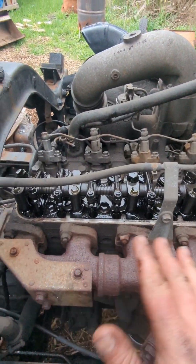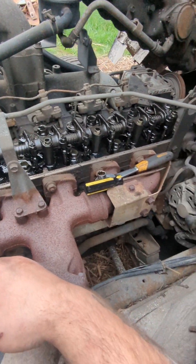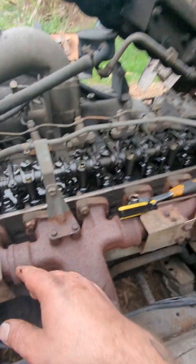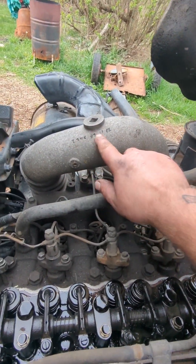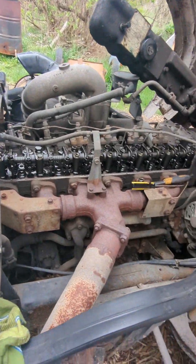0.35 is exactly where I want them. You can do them to their tightest setting — it's probably a better bet because on these diesels they seem to just loosen up, not tighten up, but I could be wrong. I'll keep bumping the starter until I check them all. I'm checking them off up here — two, three, four, five, six — writing down the ones I've already got.